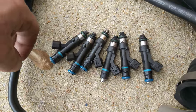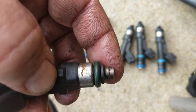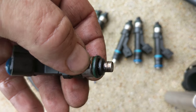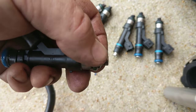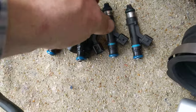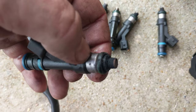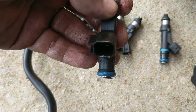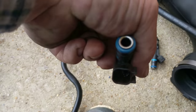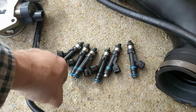Just a quick look at all the injectors. I've done a little bit of cleaning on this one — not anything too substantial, but you can see it doesn't have the gunk around it. The o-ring is somewhat flattened out so I'm glad I'm getting new ones at the auto parts store. But look at this one — that is just funky. I like things clean, so I'm gonna get that cleaned up. Maybe get some electronic parts cleaner to spray inside and remove all that old dielectric grease. It's gotten hot and broken down a bit. If you're gonna have all this apart, why not do some cleaning?